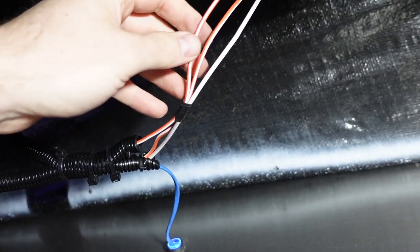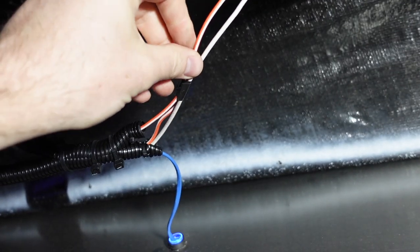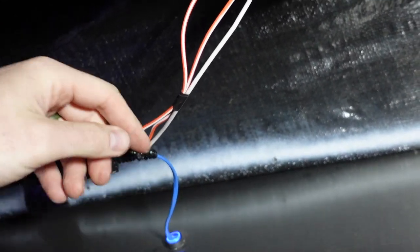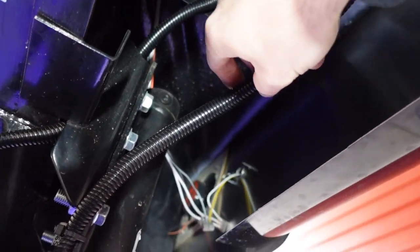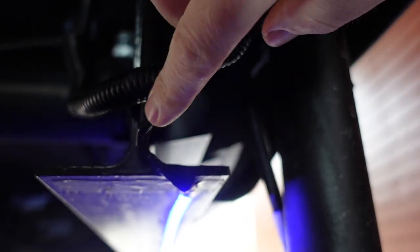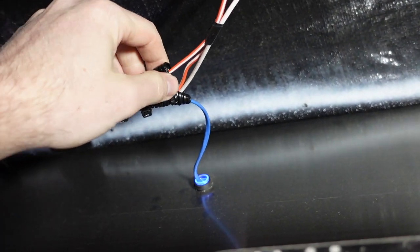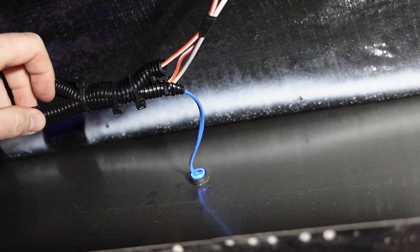Once I figured out which wire does what, I isolated the awning one light and took it away from that connection. Then I took that 12-volt positive wire coming from the BM Pro node — already feeding the step light — plus the chassis ground, and extended them down through this wire loom I added to keep everything protected and waterproof. I added another wire running all the way down to where I made my second splice. That's really the first step.